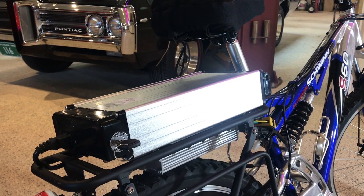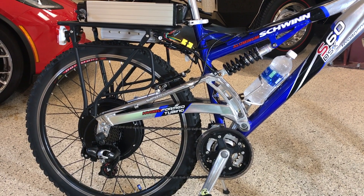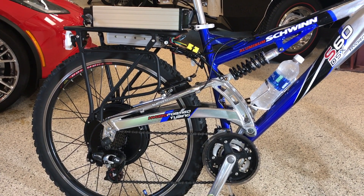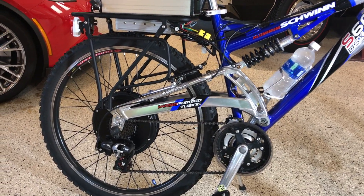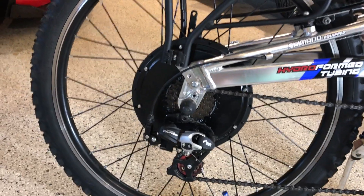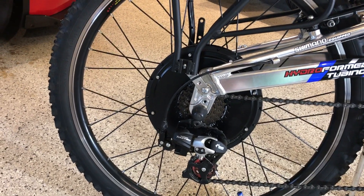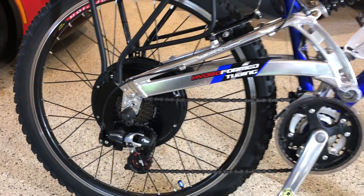The 1000W hub drive has its advantages and disadvantages relative to your two primary options — front wheel drive and crank drive. I do not believe front drives are safe on these bikes, as they were never designed to be pulled by their front forks. Hub drives are easy to mount and can be made universal enough to fit most bikes, whereas a crank drive really needs to be made for that specific bike. A hub drive, however, gets no torque multiplication or mechanical advantage from the bike's gears because it is mounted directly to the hub. When you are pedaling to assist the motor, you still receive mechanical advantage from the gearing as normal, but the motor does not.